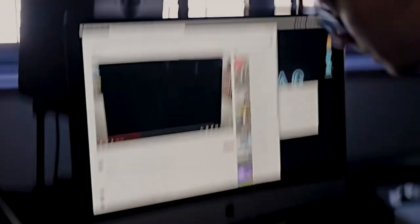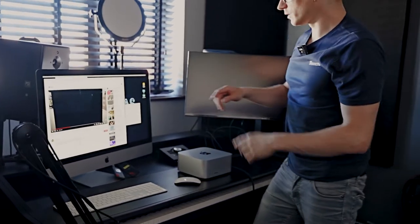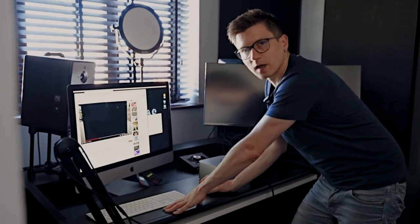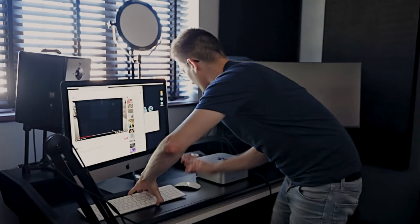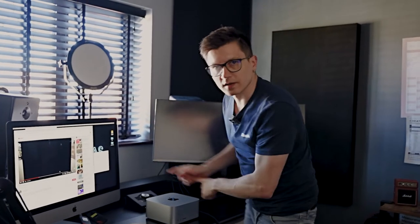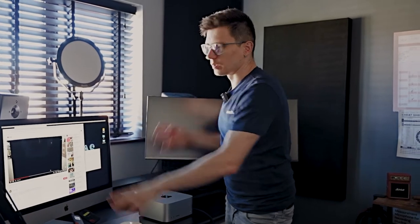So what I'm going to do is unplug my Thunderbolt cable from the Apollo Twin X because it's a Thunderbolt device, connect the Thunderbolt from the iMac to the Mac Studio, then turn my iMac into target disk mode, unplug my SSD drives, pair my keyboard and mouse with the Mac Studio, do the initial setup — the Wi-Fi, the account, etc. — and then hopefully start the Migration Assistant using the Thunderbolt cable and migrate the stuff from the iMac, which should be about three to four times as fast rather than doing it via Wi-Fi. This room is in a bit of a blind spot so I'd rather try doing it with the cable. Hopefully it works — I'll see you in a second.